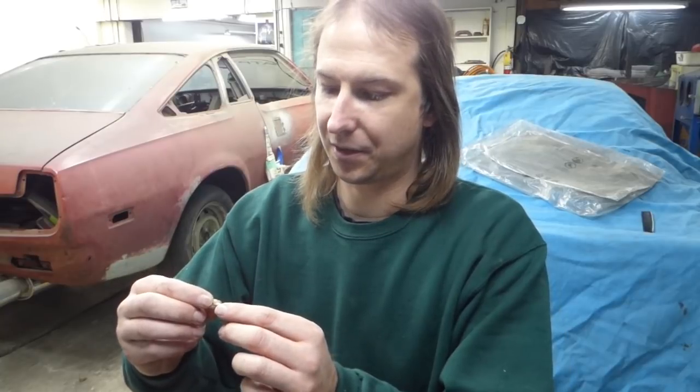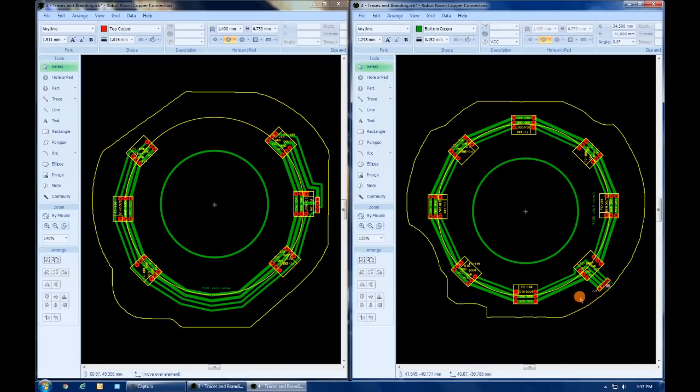They're just stringing together these WS2812B modules in series, connecting the powers and grounds together, as well as the data out to the data in, all along the circle, and ending up at a header where a connector will be mounted. So with all those boards designed, I guess it's time to make them.